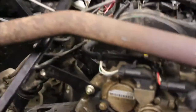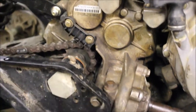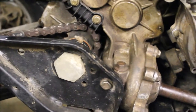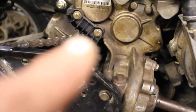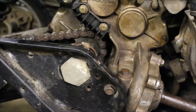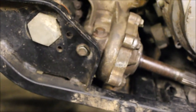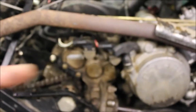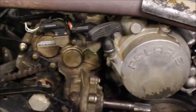So here's a quick overview of what I did. You've got a bracket on both sides of the transmission — just unbolt it here and unbolt it here. There is a nut on the opposite side after you take your clutches off and the backing plate — you just spin that out and back it off away from the tranny, because that actually holds the tranny in place. Then there's a bolt here and one on the other side behind the backing plate, and one long bolt down on the bottom that goes all the way across. I had removed the exhaust and after the clutches and backing plate were off, took the linkages off, got everything unbolted and she just came right out.